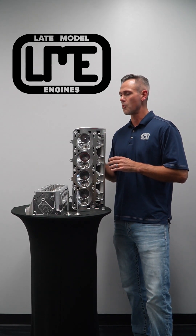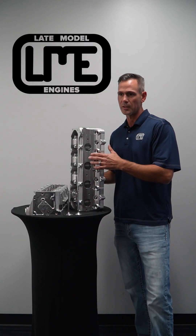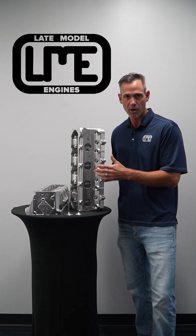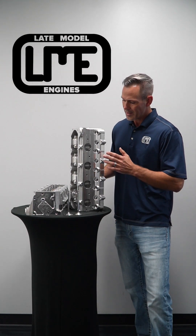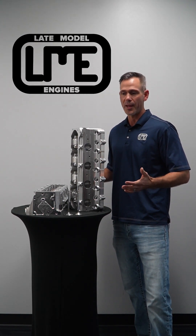This is a premium setup for guys that are looking to get the most out of your boosted or naturally aspirated application. A couple of the differences between this cylinder head and a conventional LT1, LT4, LT2 cylinder head is the exhaust port. The exhaust ports on this cylinder head are straight in line — moved roughly an inch and a half from the LT4 configuration — so it doesn't have that dogleg in the exhaust port like the standard LT cylinder heads. That straight exhaust results in a much more efficient exhaust port, more to the liking of a normal LS cylinder head.